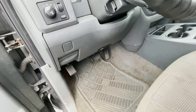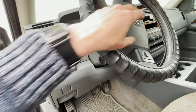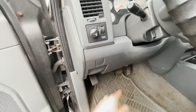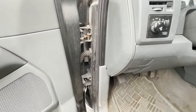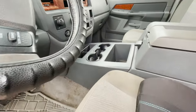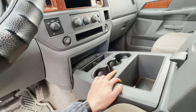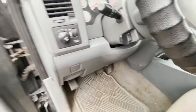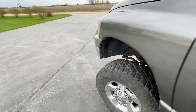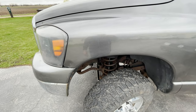It's really hard to mess up the electronics. My only advice is really be mindful of this airbag. It is a yellow connector up here somewhere. And mark your steering wheel when you do it, so you don't get it in 180. Other than that, it was just snap together, snap, snap. And yeah, so I haven't gotten the AC charged yet. Waiting on a muffler appointment currently. I haven't even taken it on a drive yet, actually.